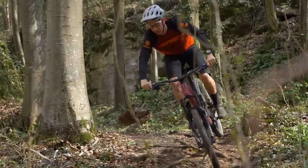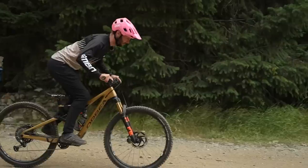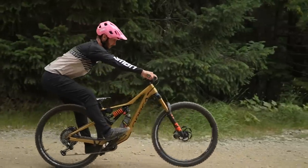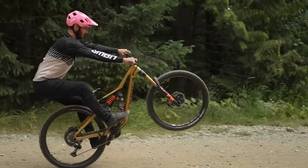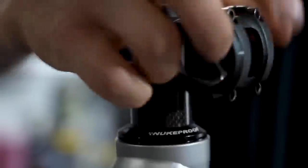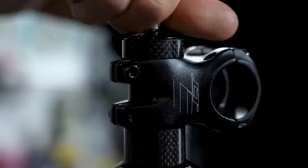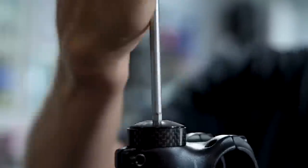This is great for off-road riding — you'll equally weight your wheels much more often without having to move around too much and you won't disturb the bike as much. The downside, as you're just discovering, is that a long chain stay that gives loads of stability at the back is kind of difficult to lean against. If anything, it weights that front end a bit more. Some people get obsessed with a low front end — that further accentuates the weight on the front end, brilliant for grip but not so good for getting the front up. So the best thing you can do is experiment with spacers and your stem.